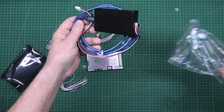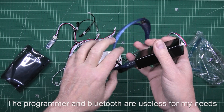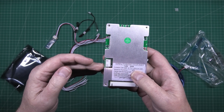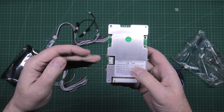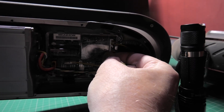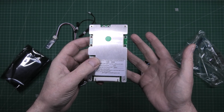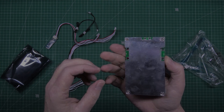The programming you can do through Bluetooth but this goes to a PC with a USB-A connector. It's got to output a certain signal to the Xiaomi M365 so I can keep the original display, controller, and everything with it. Because if you don't plug that three-pin interface into the controller it throws an error - I think it's error 20. That's the specific reason why I bought this one, because you can flash it. You need a USB ASP programmer to actually do it, which I've got somewhere.